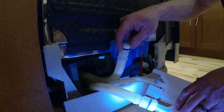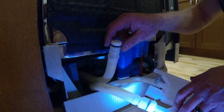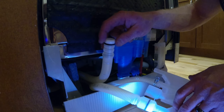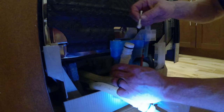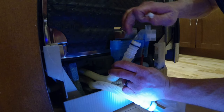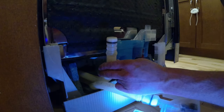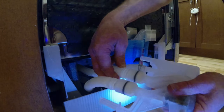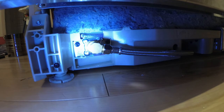This O-ring here — I'm going to reuse it. As long as you don't damage it, you can. I'm going to check for leaks later. I'm going to put a little bit of Vaseline on this O-ring so it doesn't tear when putting it back together. The water valve underneath the sink is turned back on. I'm going to keep an eye on everything and make sure it's not leaking before I put the dishwasher back together.